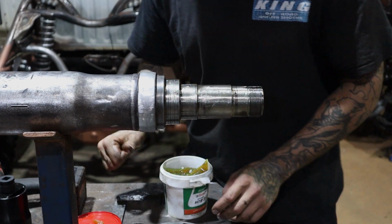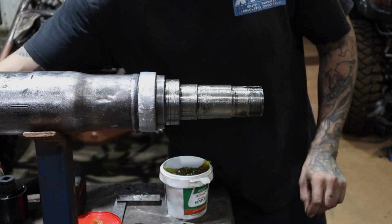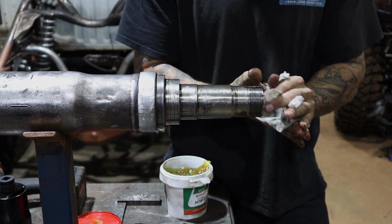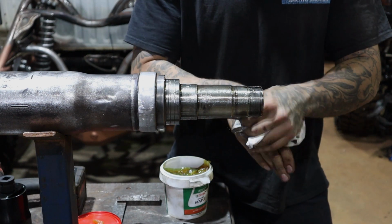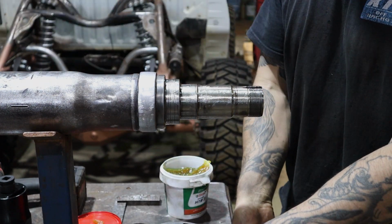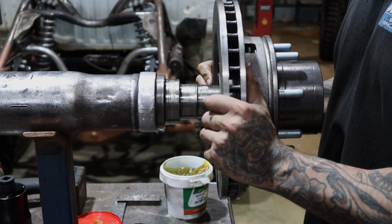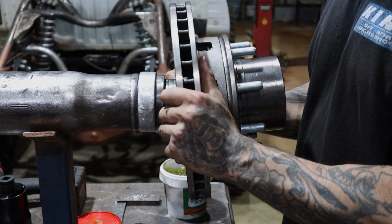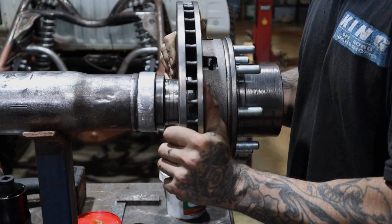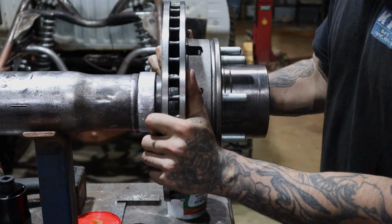That's just on there like that. Chuck a little bit on the nut here. Easy, and then make sure you don't get hub grease on your disc brake, because you'll contaminate your brake pads and mess them up before you even get them in. Now, pick this hub up, slide it on. They do have a back seal on these. There we go. That's that there.